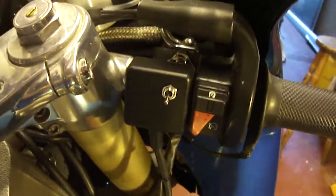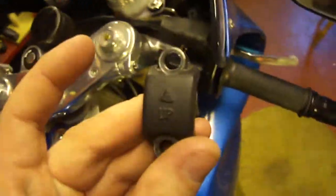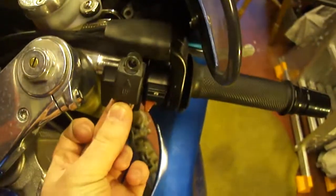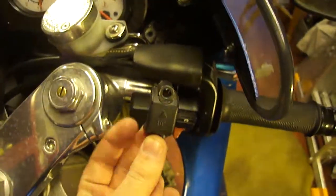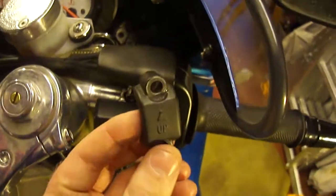In order to get it into a very constricted space, I mounted it right in front of the clamp for the brake lever. The original clamp uses a piece of aluminium — here's the original aluminium clamp, a pretty generic Japanese clamp. So I made a stainless steel replica of that with an extended section that's shallower so it takes up less space.